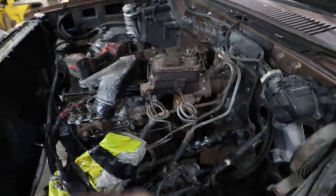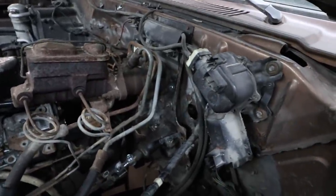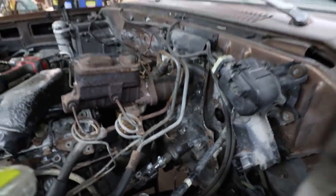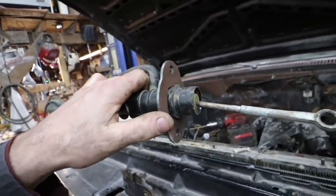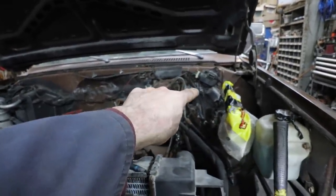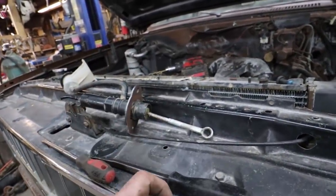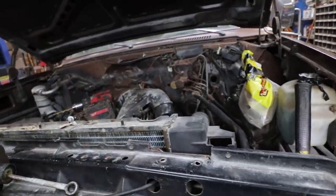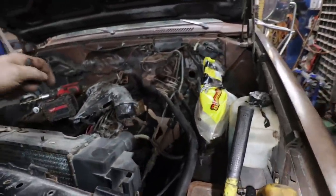So that's good. Brake pedal is bolted down. So now what I'm going to work on is the firewall, the slave cylinder. I basically got to open up that hole a little bit and then fit my adapter on there properly. I kind of want to bring this up a little bit, so I'm just going to die grind the top of that out a wee bit more. And I'll fit this in. We'll just do a dry fit, see how it works with the swing of the pedal there. If she's all golden, then we'll drill some holes, get that bolted in, and then that section of it's done.